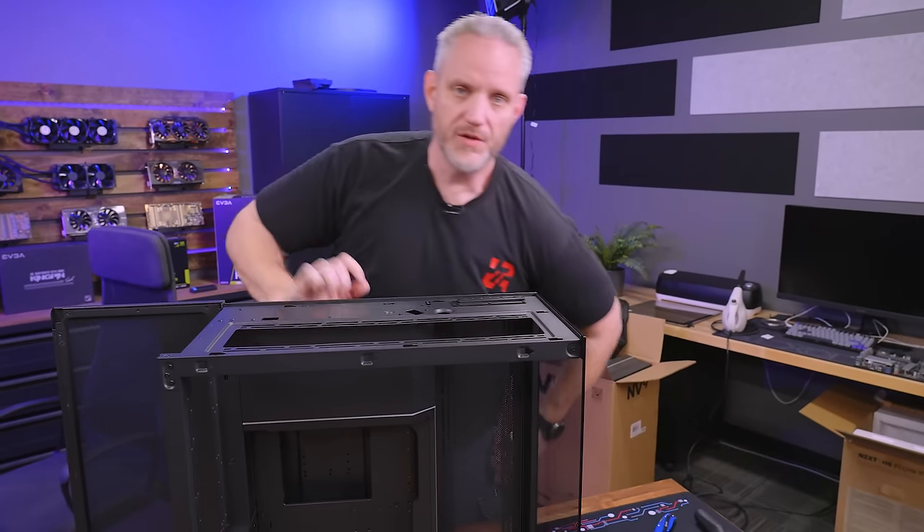So let's talk about installing the motherboard. The GPU sag bracket attaches here, if you're wondering. To try to get the motherboard in, obviously you have a lot of stuff in the way — the EPS power up here is kind of blocked. Rather than finagling the board in there, this just slides over and then down. You can see the RGB is just on pogo pins — little spring-loaded pins. The other cover on the back right here has a thumb screw, and it should slide out like that. Contact pins on the bottom right there. I love pogo pins — the best thing ever. Now we can take our motherboard and set it down inside. We actually do have some room, but not a lot — not a lot of room to get a 24-pin into there. So this is still a concern of mine.